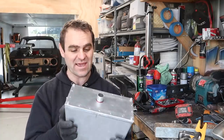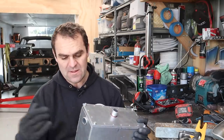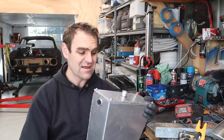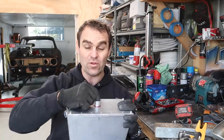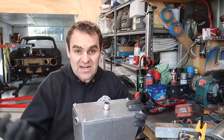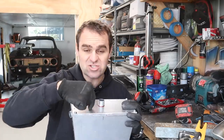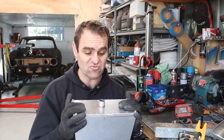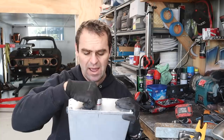I'm really happy with that — we're actually working our way through it. As I mentioned at the start, this is not a simple straight container. There is quite a lot to think through going into this — obviously oil in and oil out, but there's also breathers to consider. There needs to be two breathers on this tank. One is for the crankcase pressure building up in the engine that needs to go somewhere. In this situation I've got it all here, so I'm going to run the crankcase breather straight into the dry sump tank, which is the way most dry sump engines are run.